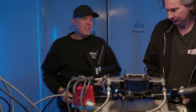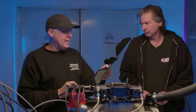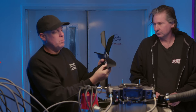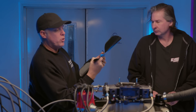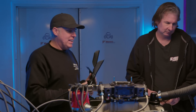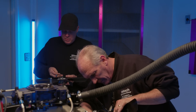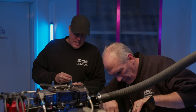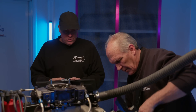Next up, we decided to go with a plastic flex fan because it has softer blades than the steel one, so we figured it's probably going to eat less power. The theory is that as RPM increases and it's drawing more air, the blades flatten out and therefore take less of a bite of the air and eat less horsepower. One thing to pay attention to when installing a fan: make sure you're spinning it the right direction, because there is such a thing as a reverse rotation fan if the belt arrangement on the front of the engine spins the water pump the wrong direction.